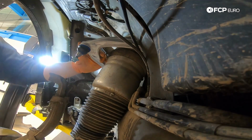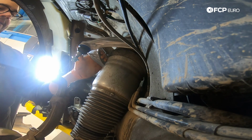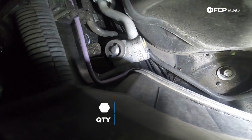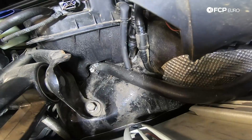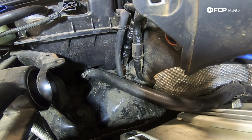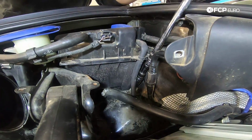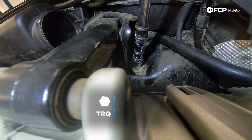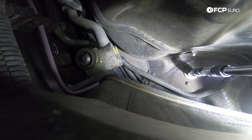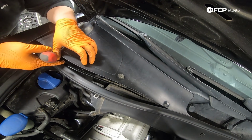Now that this is situated, follow me back up top under the engine bay and we can feed our 3 16mm bolts back into the strut tower. Now back up top, we're going to go ahead and start our 3 16mm bolts back in. We're going to torque these top 3 16mm bolts to 37 foot-pounds. There's 2. Beautiful.